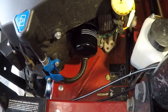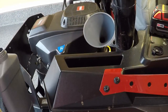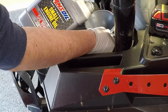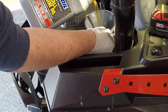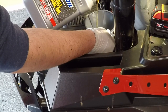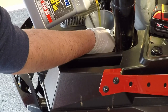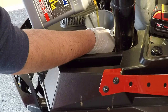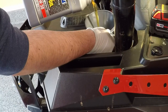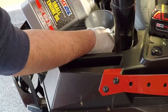The oil change is nearly done — I just need to put the new oil in, run it, and check the level. I'm putting exactly two and a half quarts in, accounting for the little bit used to pre-fill the filter. If you're doing this for the first time, put in a little less than you think you need, run the engine, and check it, since the oil filter isn't fully pre-filled.